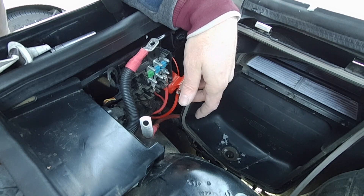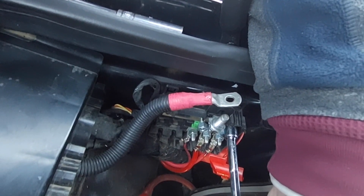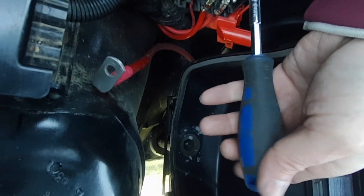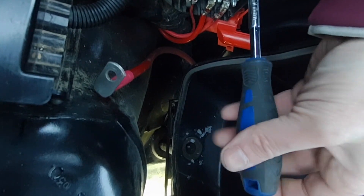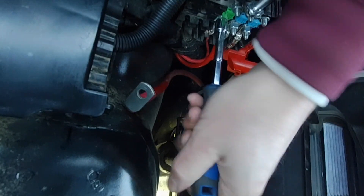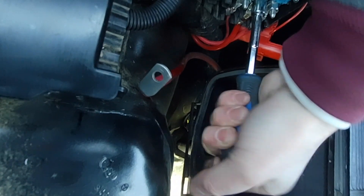I'll get back with you when I get it all back together. Just getting it all back together here and I'm going to use a nut driver to tighten everything back up. You don't want to overtighten this stuff, and because some of it's kind of connected together, you don't want the things twisting around. Snug everything up just a little, then go back over it and torque them all after. When we do the final torque, we go like that a bunch of times — that just moves the connector around enough to make a good connection. You want to bring them up firmly, but not too tight.